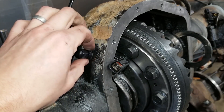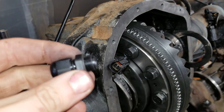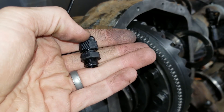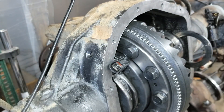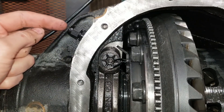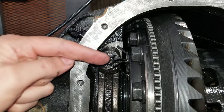That feels a little loose in those threads — it's probably an M12 by 1.25 if I had to guess now that I'm looking at it, but I don't have that tap and the half-inch 20 worked fine, so good enough for me. With that cable gland installed, now we want to run our wires through that and then hook them up to the wiring on the locker.